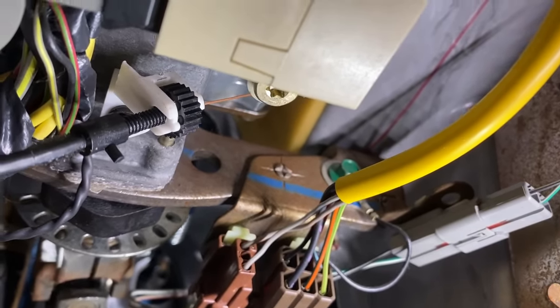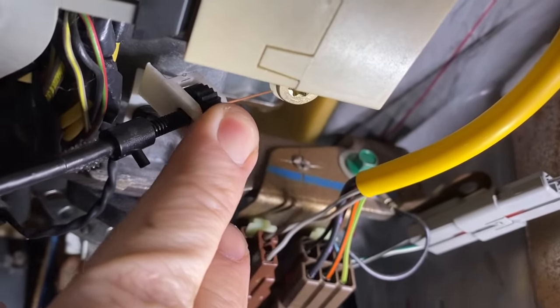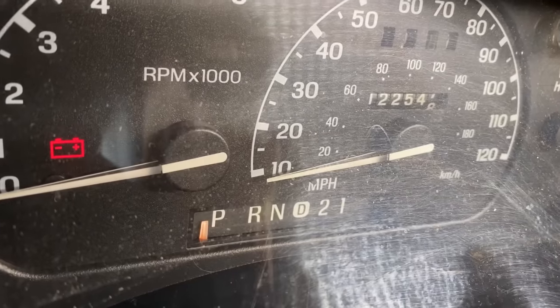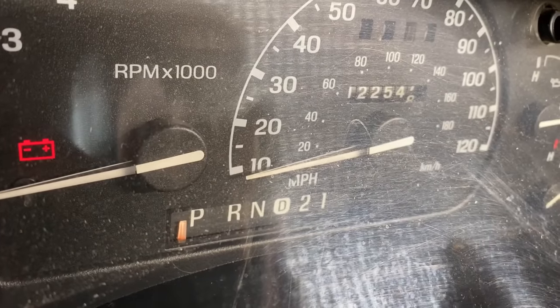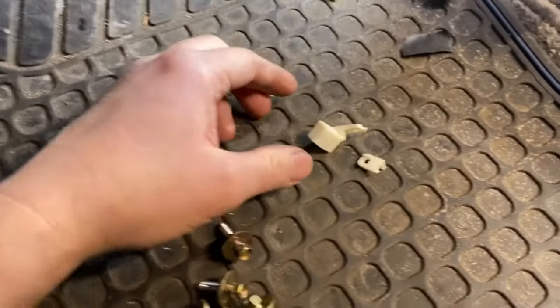In between there's an adjustment — that little thumb wheel right there. As you spin it, you just spin it by hand in the hole; it's like a fine thread adjustment on there. That allows you to perfectly center your transmission shift indicator so you can adjust it after other repairs have been done and everything lines up perfectly so you know exactly what gear you're in.